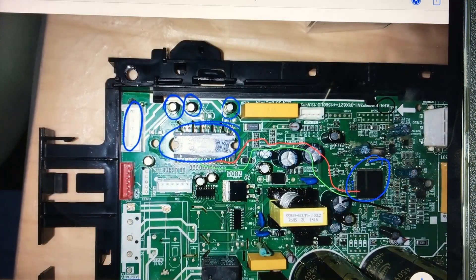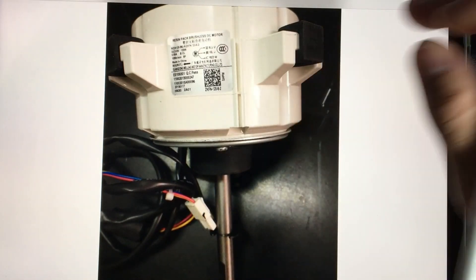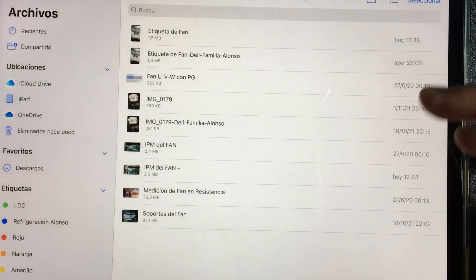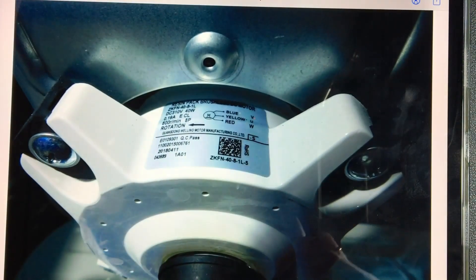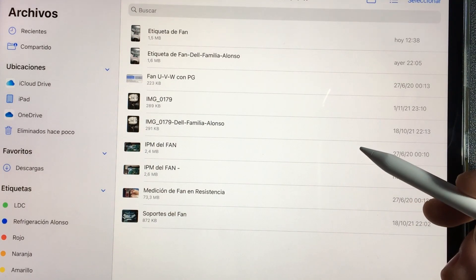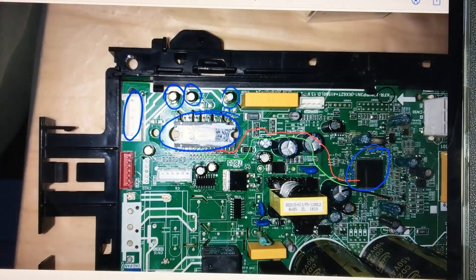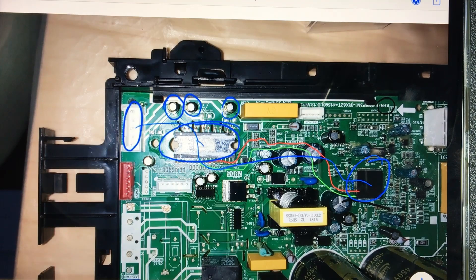Those are the details of a UVW fan. To keep in mind: we will see some photos. There is another photo of a UVW fan — they are very solid, very robust, and heavy. They have permanent magnets inside and good rubber pads to hold them, as we can observe here. Regarding speed measurement, remember that it is produced through the loose cable. The loose cable — the one of the three that remains free — produces a voltage drop which informs the processor through the IPM of the speed of rotation. So it is like they have an embedded hall sensor, just as we discussed with inverter compressors.